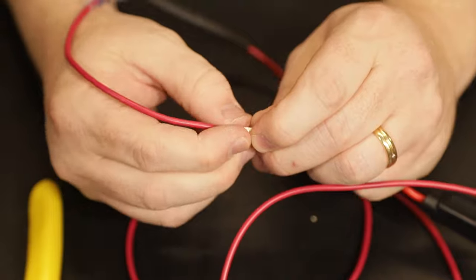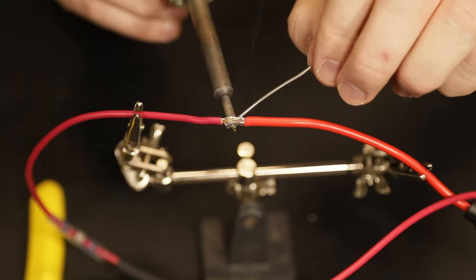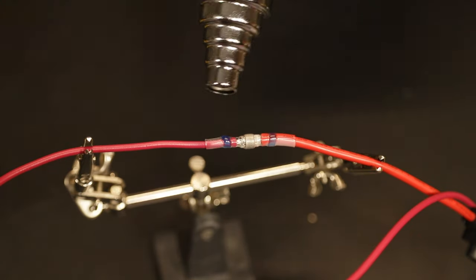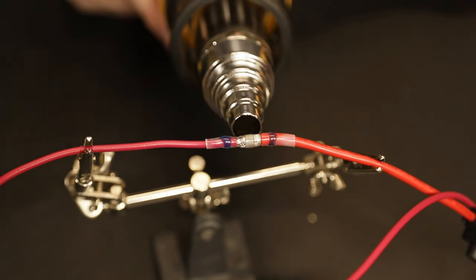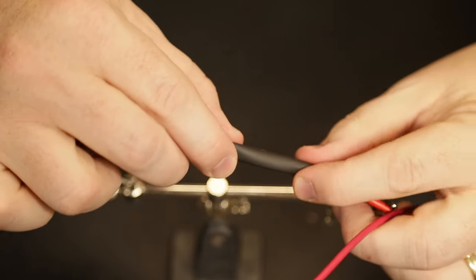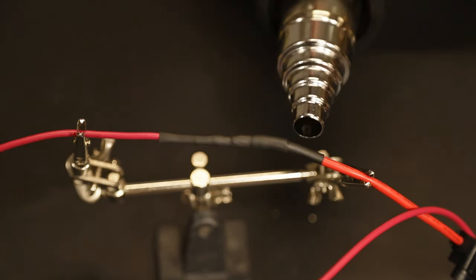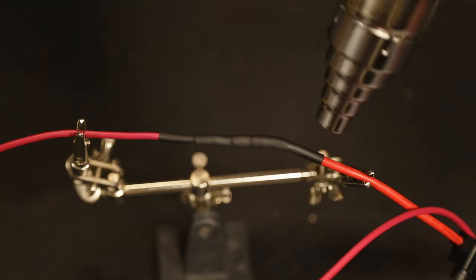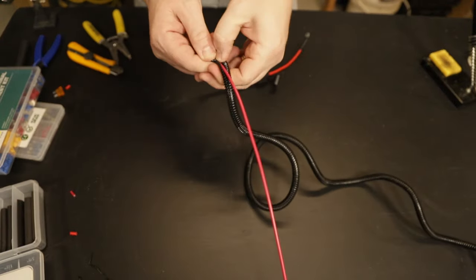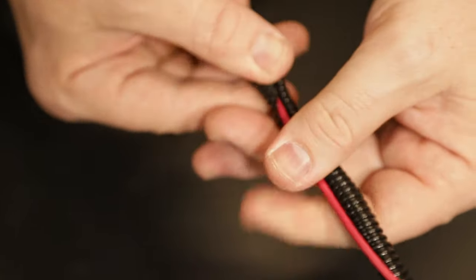I'm going to demonstrate several different soldering techniques during the course of this video. In this one I'm pushing the strands of the wire together and then squishing them down and twisting them together. In every case I'm going to attach the wires, solder the joint, and then add at least one — and in most cases several — layers of heat shrink, because things in cars get jostled around a lot and you especially don't want your positive lead to rub through and short out. With that primary wire all soldered up, next it's time to get it into the wiring harness so I can run it to the back of the truck. This is a little bit tricky but if you're lucky you can slide your thumb through that slit and guide the wire in, though you may have to do it in tiny sections at a time.